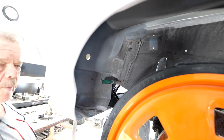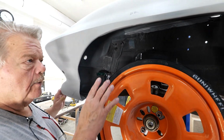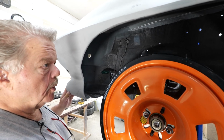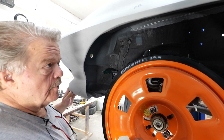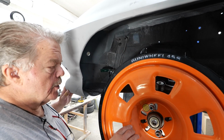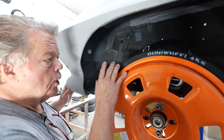It's pretty easy to glue them in. It's not like it's a hard job. When you're putting the front end on, if you look at the video we've already done with our one piece, it applies the same to the jig fitted front ends. Where we bond the back of the cowl section of the front clip is the first thing that we do. And then we work our way forward with fitting the hood.